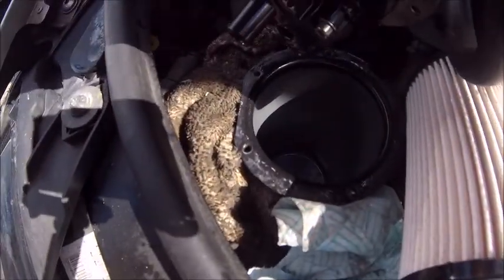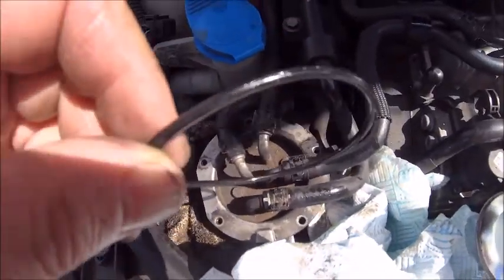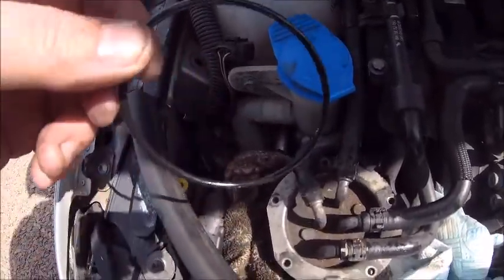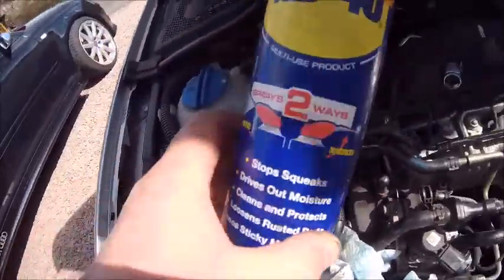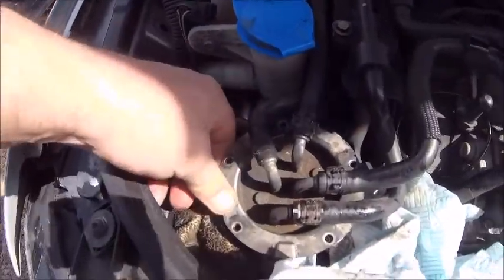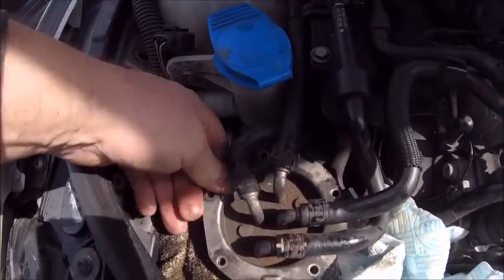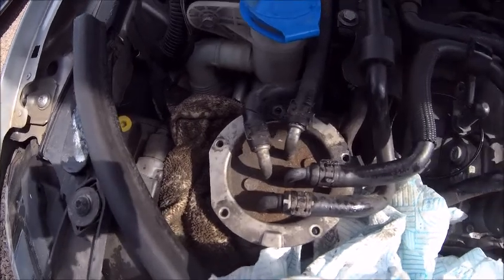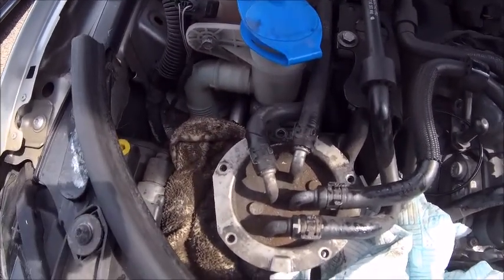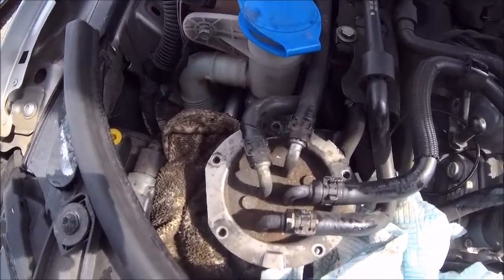Let's get this all back together. So when you do this, obviously you're putting the new o-ring on. Give it a good blast with the WD-40 around it and ease it on nice and gently bit by bit and it will then kind of snap in at the very last minute. Right, bolt it back up. I put fuel in there before, obviously, to top that up again. Put it back together again, put the screws back on it and then I'm going to get it jacked up and we'll get the oil dropped. There you go, screws are back in.